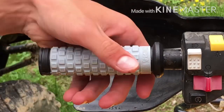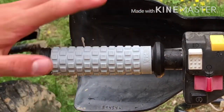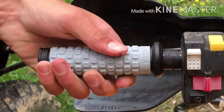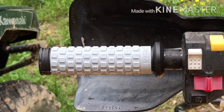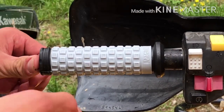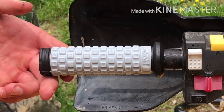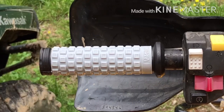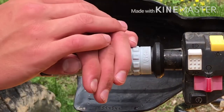After you have the soap in there it'll move a little bit at first, but then that soap will dry and it'll be fine. That actually helps you adjust it where you want it. Right when you get it with the Pro Taper logo where you want it, that's pretty much how you do it. I'm just going to do the other side off camera because it's the same process. I wanted to make this short little how-to video.